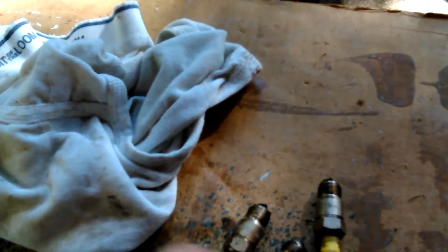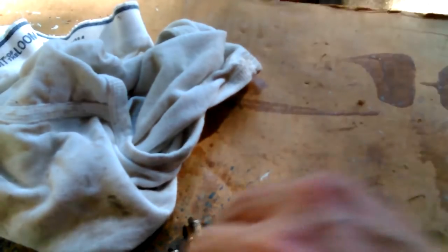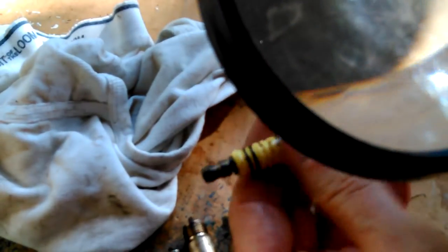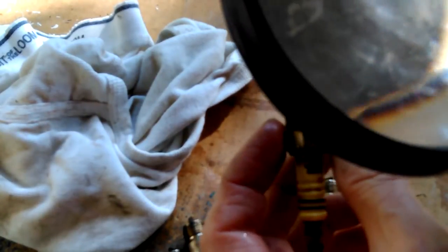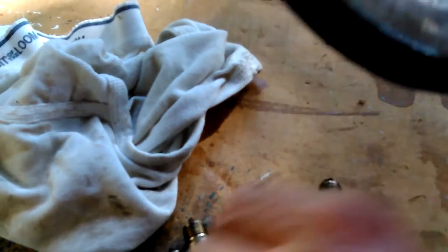When I had an engine, the original engine, in here, it fouled two of the plugs regularly, even though it ran good and everything. It was valve guide seals. They'll do that on the Chevys and the old Dodge engines. The 318 in that van does the same thing. I just haven't ever felt up to trying it. I made a little tool years ago. I welded the front end of a spark plug onto a quick change air chuck for an air hose. Then you can put air pressure in the cylinder, and you can pull the rocker arm and the valve spring without dropping the valve down in the cylinder.